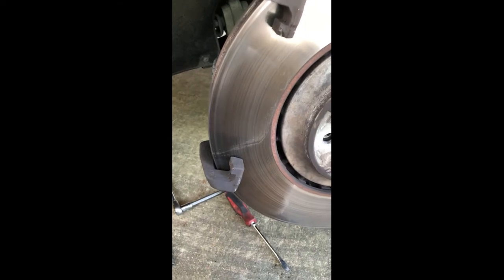There's a piece of a brake pad right there. This side is really bad — this side's got a big groove in it. Look, that's like a spoon. I'm going to get some new rotors on this side too, so let me get it done, y'all.